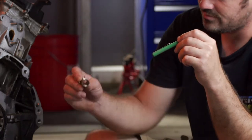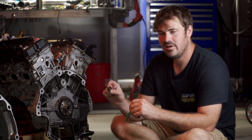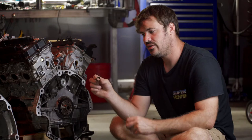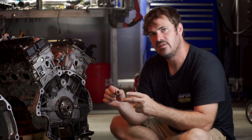Even if you've bought an aftermarket clutch kit and determined that the bushing in it is not magnetic, there is much inconsistency with the tolerances of the ID and OD of these in the aftermarket world. It may slip onto the transmission and feel smooth, but once it gets to operating temperature, the brass is going to expand because it is not as dense a metal as steel, and it's going to take up that tolerance. So if you have one that shows all the issues I described but only does it when the vehicle is at operating temperature, this is still likely your culprit.